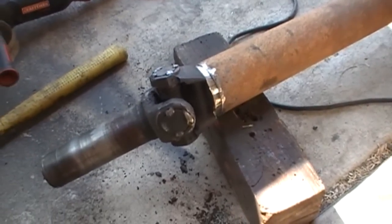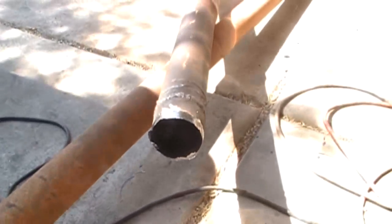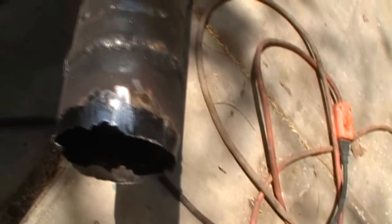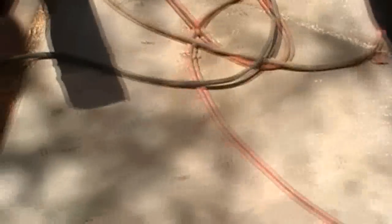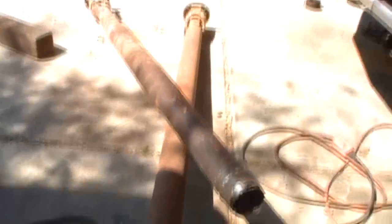There's sort of the finished product. I also forgot to mention — since I wanted to save that yoke and the drive shaft was junk — you've got a junk drive shaft, so don't grind more on the drive shaft, don't worry about messing it up. Save your yoke. That's basically what I did. Except for one thing I told you about clocking the drive shaft — I'm a couple degrees off, but anyways, there you go. Just shortening a drive shaft.